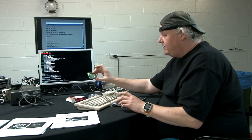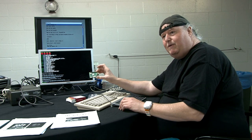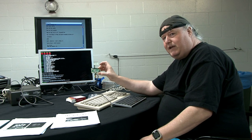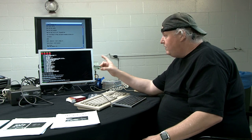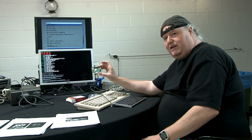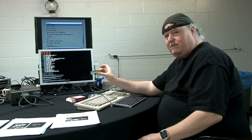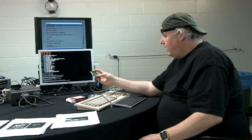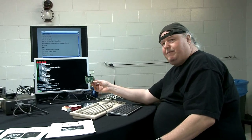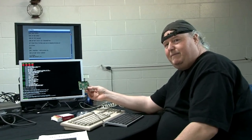What's nice about that is it'll give you a lot of features, including a 68,000 accelerator, which is nice. You can set the CPU from anywhere, 68,000, 010, 020, 030, 040, and you can set it in software and reboot, it's there. It also gives you an RTG board, full HD with HDMI interface with the audio. It also, of course, gives you wireless networking to give you a TCP/IP socket, which they're still working on and debugging.